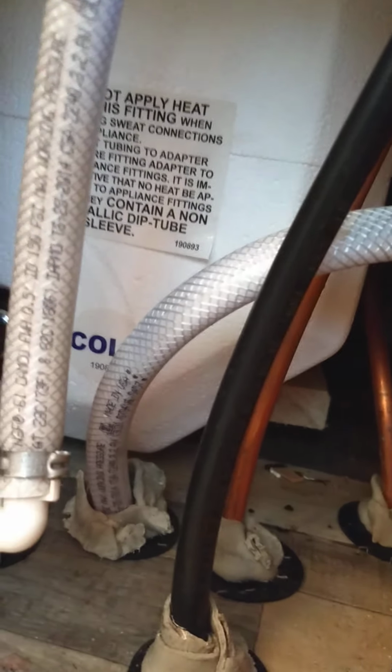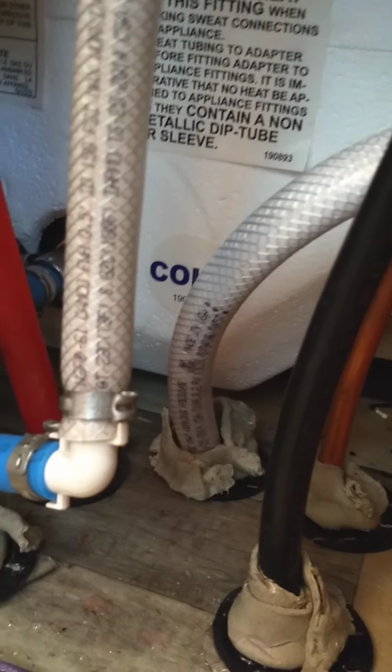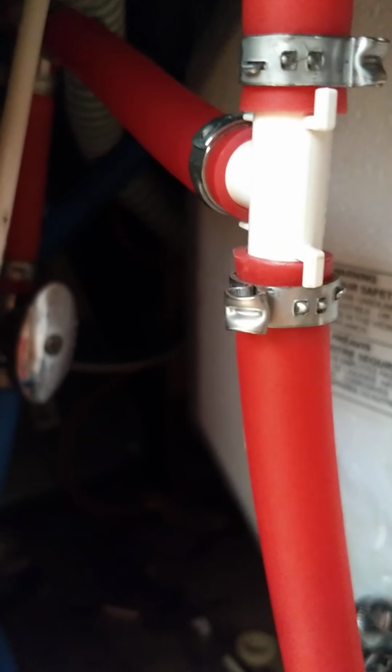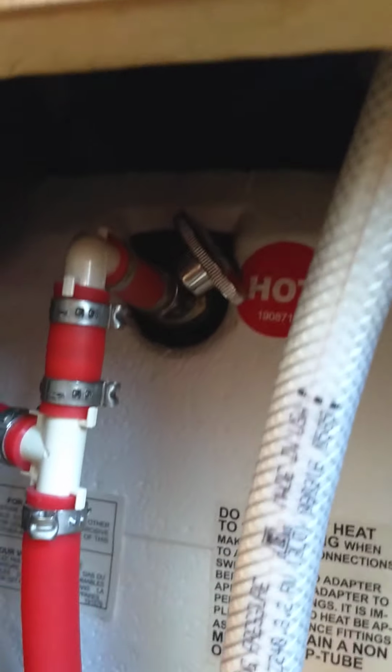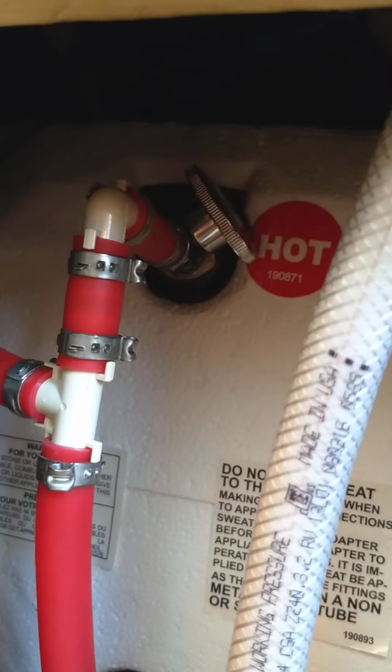So because of that, you have a bypass line. If you look way back there, you can see another valve that is parallel with the line that runs between the hot and the cold line. That's called a bypass line and a bypass valve. Right now we're in bypass. I'm going to change it over because I've de-winterized it for you. Because all the antifreeze has been pushed out with fresh water, I'm going to reverse these valves.